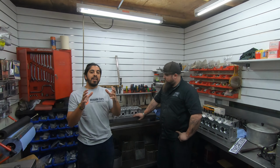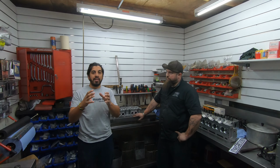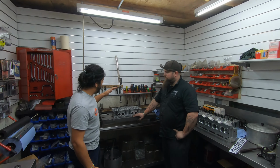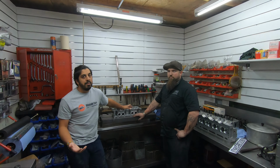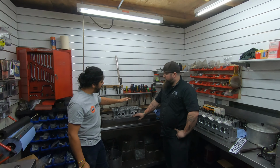So I can't use the original Mazda front wheel drive head due to the dizzy location. If I put it in my rear wheel drive, I'll have to cut a hole through the firewall. So what you're able to do with the F2Ts is run a rear wheel drive, either HB99 Mazda or a van head. So I've sourced an injected van head.